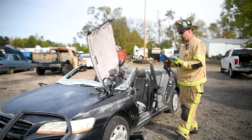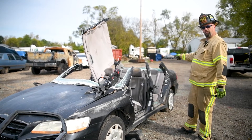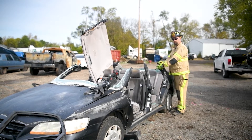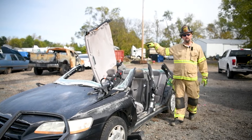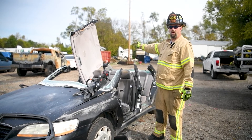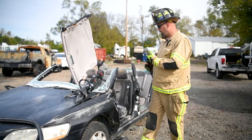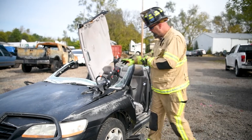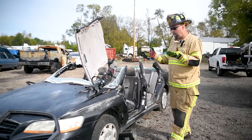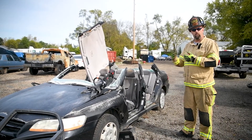As you can see, we've now removed all four doors and cut A, B, and C post on the driver's side — remembering that we crushed the C post down on the driver's side first — and also cut A, B, and C post on the passenger side, making four cuts on the C post because we did not crunch down first. Let's take a look at our battery life after all of this. We're now down to one bar, so obviously we've done a lot with this 11C so far. Next, we're going to move on to a dash roll.